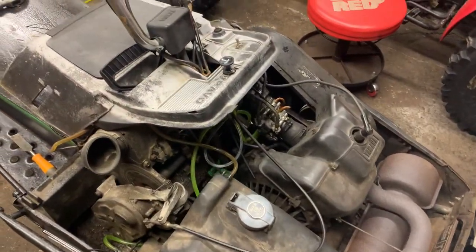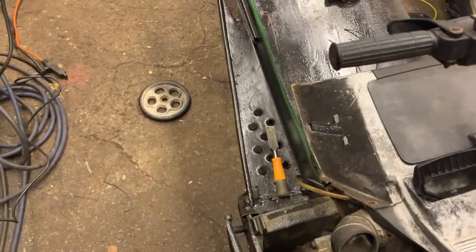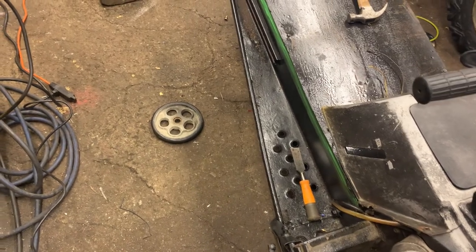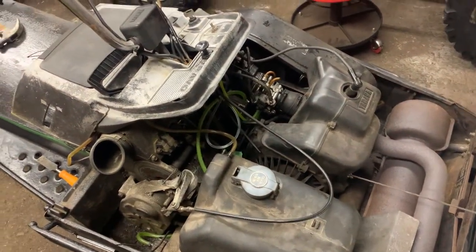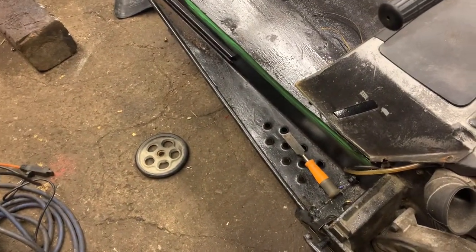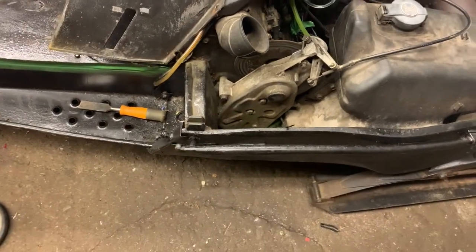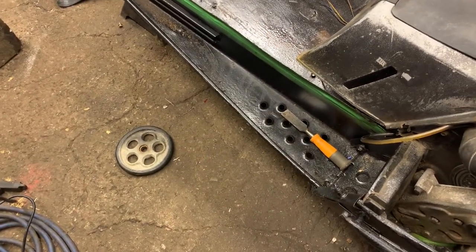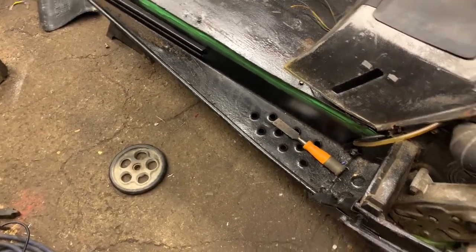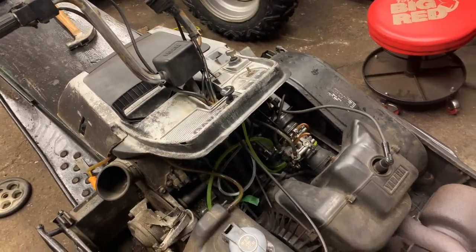She runs excellent - new fuel in the gas tank, new spark plug. The idler wheel is off so she definitely needs undercarriage work. I'll give her a little run to make sure the carb's good after cleaning and that the fuel lines are all working. We've got another problem though - looks like a bolt sheared off on the track, which is pretty sad. The track needs to be looked at - I can tell it's a bit too tight because it's binding. The skis are done, the bodywork is all patched up, and the primer is hooked up with all the lines connected. Pretty much done for the most part - just need to sort out the track.